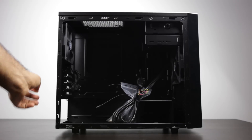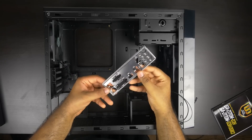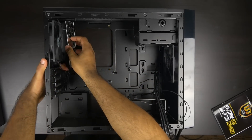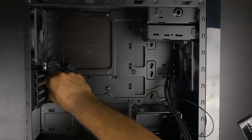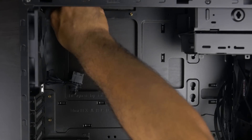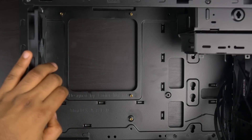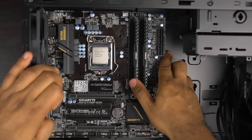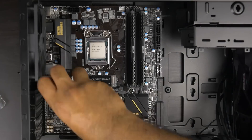Now that the M.2 is installed, we can prep the PC case. Remove both side covers. The first thing I like to do is install the motherboard I/O plate — make sure alignment is correct based on motherboard orientation, then install it at the rear of the case, nudging it securely in with the handle of your Phillips head screwdriver. Next, install the standoff screws that will hold the motherboard into the case, checking your motherboard layout so everything is aligned. Once standoffs are in place, set the motherboard inside and use the rear I/O plate to align everything, then secure all the screws.